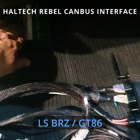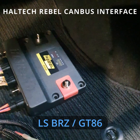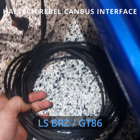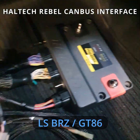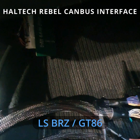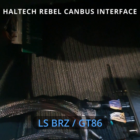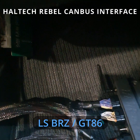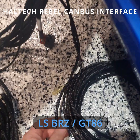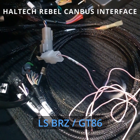Alternatively, via CAN bus the translator will also enable the standard fuel pump control module to work when it triggers the fuel pump to come on. Similarly with the fans - you can wire the fans directly to one of these wires here so the fans are powered directly off the Haltech, or the two fan speeds are also transmitted via CAN bus to the translator, and the translator will turn the fans on through the standard relays. This also works for air conditioning relays. You can also use the standard wiring for the starter motor, or wire the starter motor up to one of these wires. There are a lot of options and plenty of ways you can go about doing things.